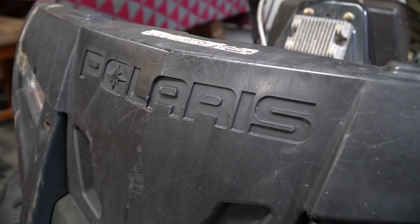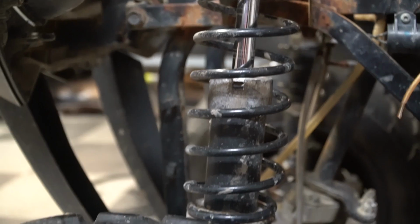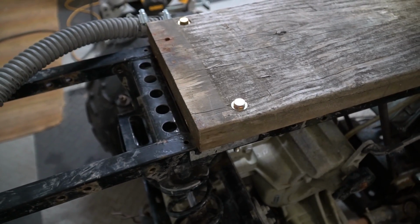We're pretty much done on this ATV today. We got some good things accomplished. We installed the bigger Mikuni carburetor, did 38.2 miles an hour, which is respectable. We still need some kind of vibration damper, but we reinforced the frame. It's so loud I can't even understand it, but it'll fit in perfectly at Busco Beach.